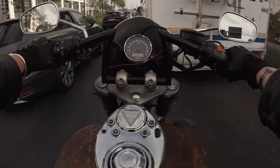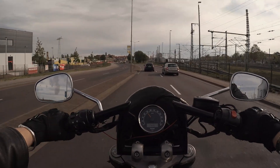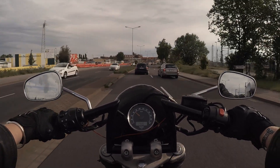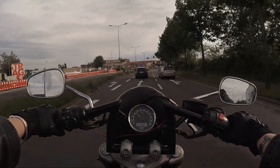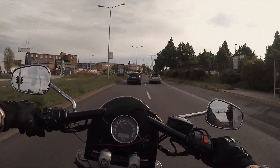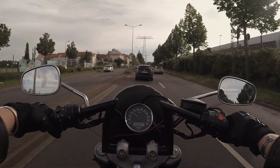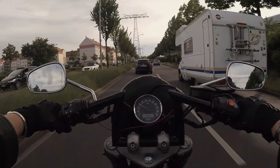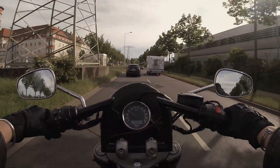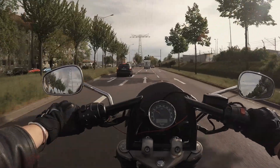Filtering is easier because I don't need to worry about the bike being so wide. Here's a little pro tip — although I'm no pro: don't do like me and just jump on the bike and go out on the road in rush hour with bars you just installed. Test them out, test the fit, see if the throttle works, see if all the levers and cables work before you take it out into traffic. I didn't do that because I didn't have time. Fiddling with the indicator for so long meant my battery was basically flat, the bike wouldn't start, so I had to jump the bike and just go into traffic with brand new bars I didn't even know would work.